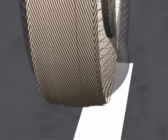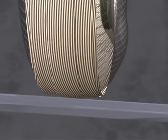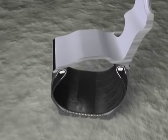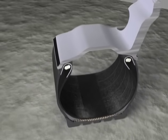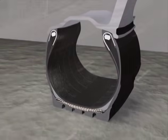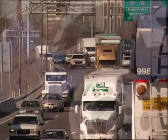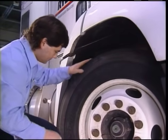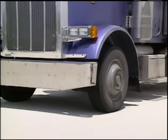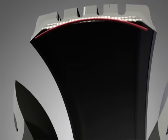By flexing and changing shape, the steel together with the compressed air inside the tire helps absorb shocks from uneven road surfaces. The sidewalls transmit steering, driving, and braking forces from the wheels to the tread, as well as forces from the road to the suspension system. Although sidewalls don't get the kind of wear treads do, they are exposed to the elements, so sidewall rubber uses special compounds and additives to protect it from UV light, weather, aging, and curbing.